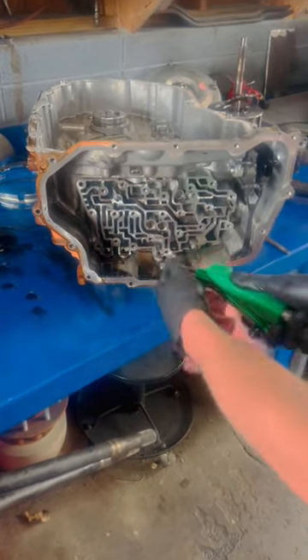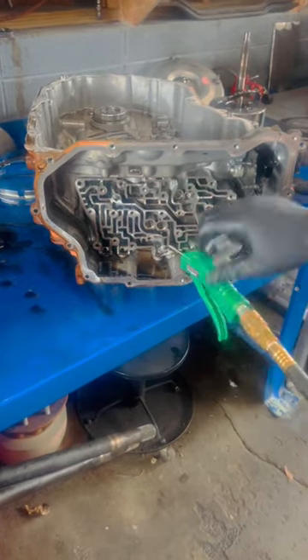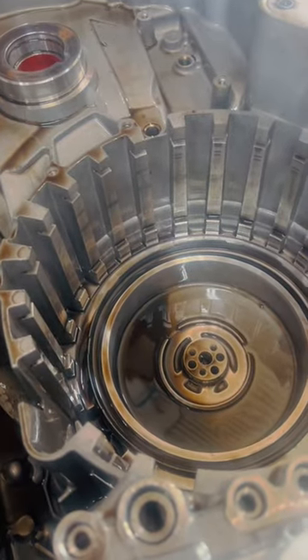We have all our inlets for our clutches down here. I know it's this one because I've probably rebuilt about 47,000 of these. Watch the piston here as I apply air — watch what happens. Pops right up.